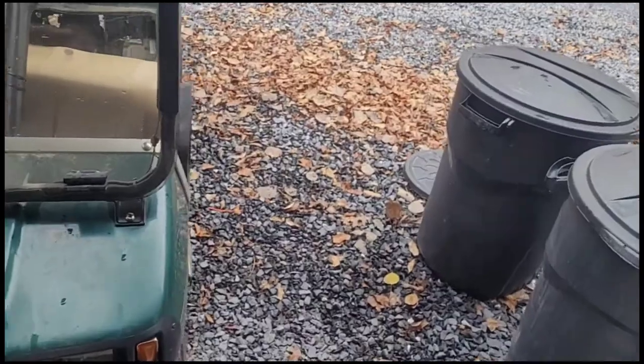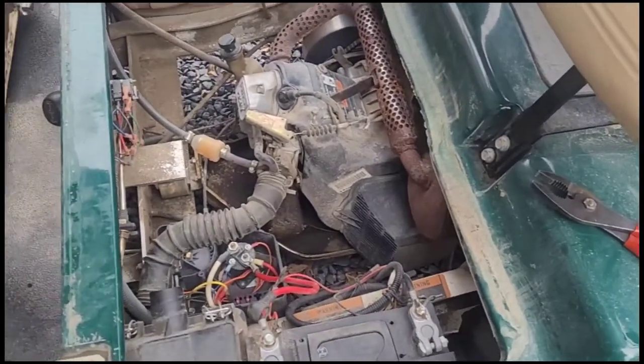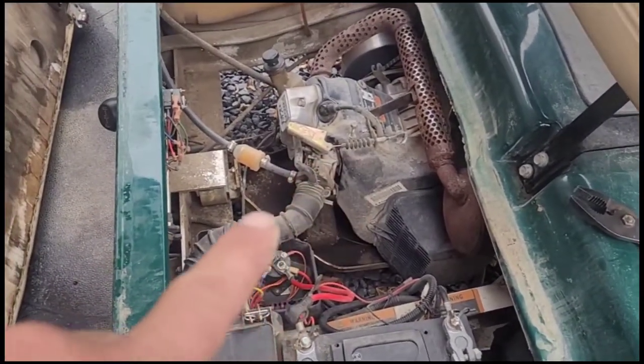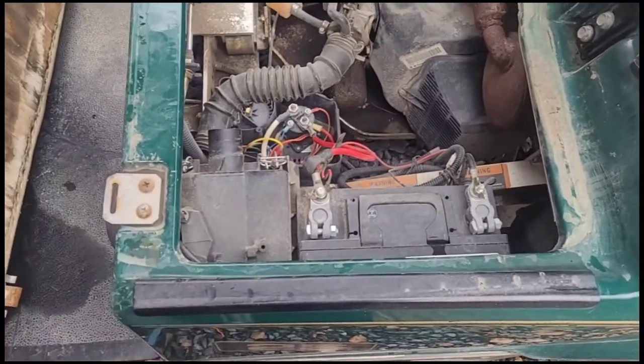This time around I'm going to be doing some modifications on my 2002 Club Car. It's gas, it's got the FE290. Check out some other videos I've been working on — rebuilt the motor and whatnot. Since I rebuilt the engine and advanced the timing a handful of degrees and did some jet changes in the carburetor, I am now going to modify the airbox.